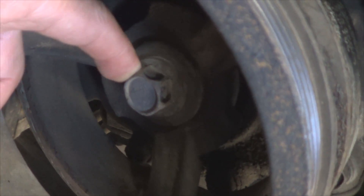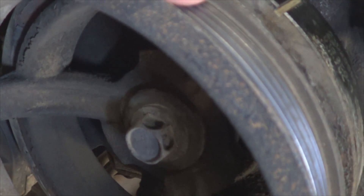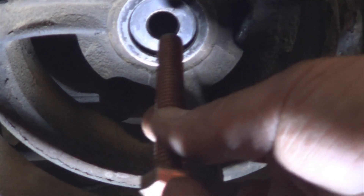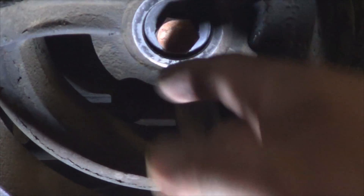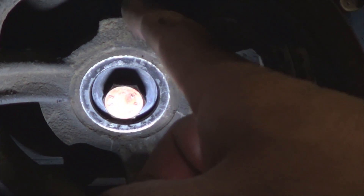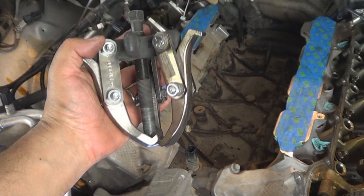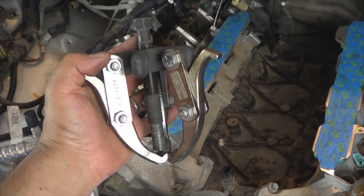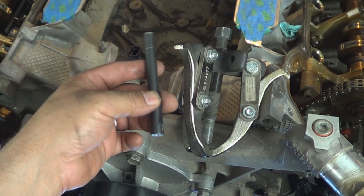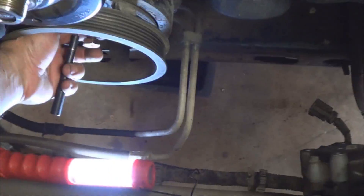Once all the marks are aligned, remove the crankshaft center bolt. Air tools are probably your best bet, because that way the pulley won't rotate when you loosen it — otherwise you're going to have to hold the pulley with a crankshaft pulley holder while you loosen the bolt. Once the crankshaft center bolt has been removed, insert a small bolt that goes inside the cavity without touching the threads — this will give support for the puller. You're going to need a three jaw puller that hooks into the tabs that the harmonic balancer has for this particular purpose. The set also came with an adapter meant to go inside the cavity where the center bolt was, but for the 4.7 liter this adapter ends up being too short — I wouldn't be able to use the puller with it. That's why I ended up using this bolt instead of the actual adapter.